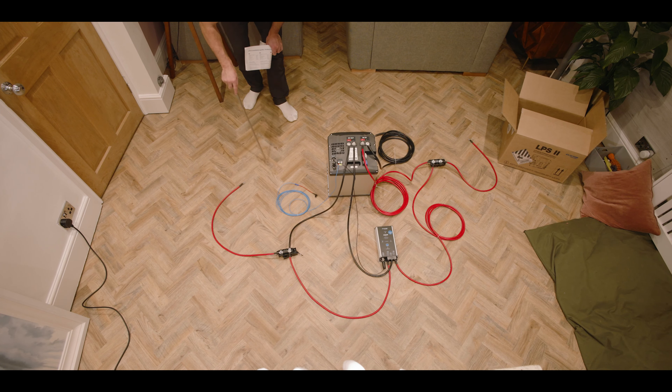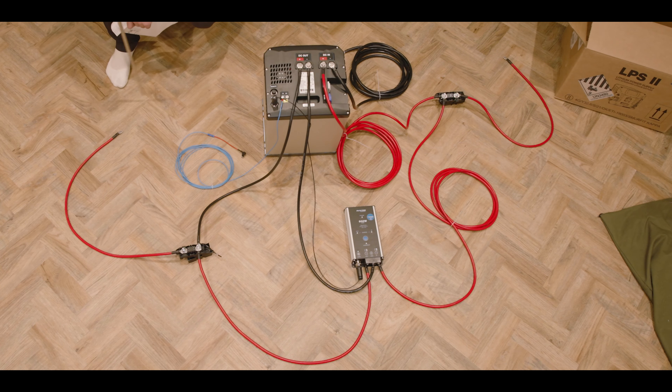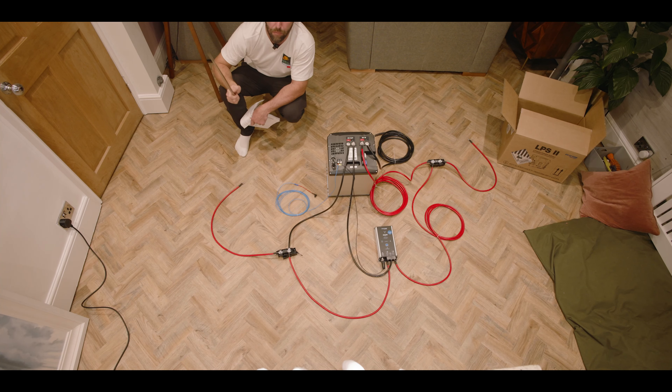This fuse should be no more than 180 amps, but should be sized according to how many devices you've got on it. To be crystal clear, this will be your fuse box that goes out to your Maxxair fan, your fridge, whatever else for 12 volt — water pumps and all that kind of stuff.